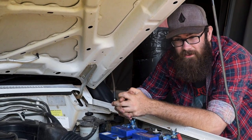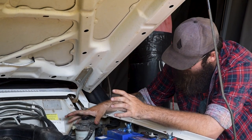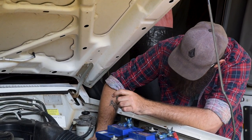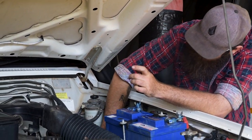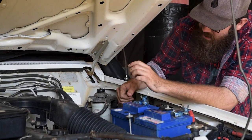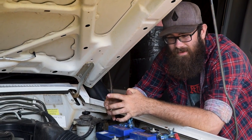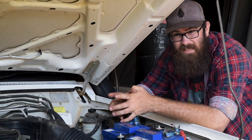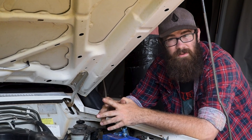The last thing you want to do when you get around to this side of the vehicle is drain your fuel filter. There's a little tap down the bottom — just drain it out. Have a cup underneath with a little hose that comes out the bottom, a clear cup so you can catch what comes out. If it looks particularly bad — sandy, dirty, murky, watery — it's time for a new filter.